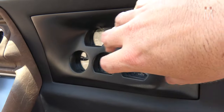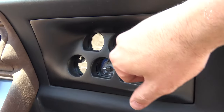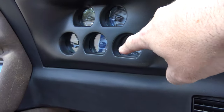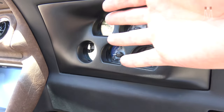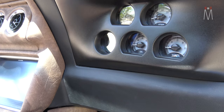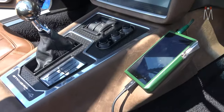I ended up relocating the gauges to fit in this area, and this panel is all on magnets — held on by four 13-pound magnets, so it's very strong but you can pop it off to access the HVAC and the Dakota Digital brain behind it. This was already in the car, so we just problem-solved for the area we had. He likes the look of the modernized gauge dashboard — this is a modern '79, but we still respect that factory style.